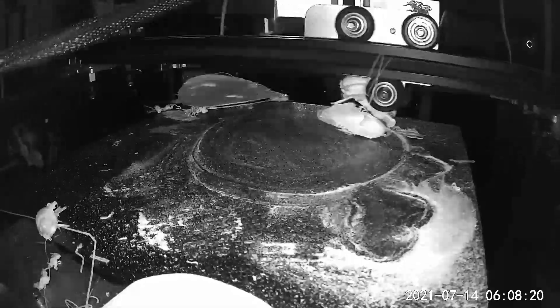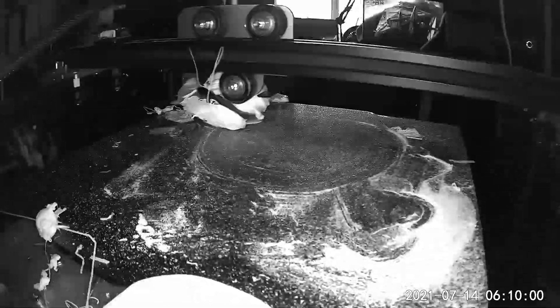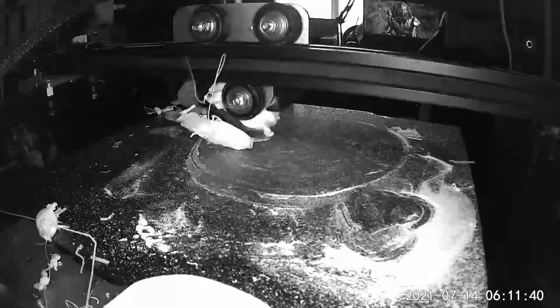I'm sure you've seen all the horror photos online of various boogers, but what do you do when you get in that scenario? Let's take a step back and talk about what causes these boogers. Sometimes when filament doesn't bind to your bed or to your part, it has to go somewhere as it's coming out of your extruder. In lucky cases, we get the spaghetti bomb that many of us are familiar with, but sometimes it just tends to curl back upon itself.